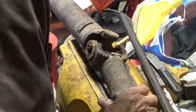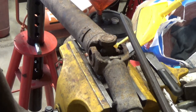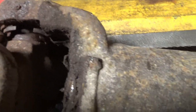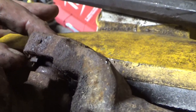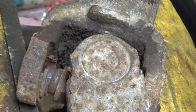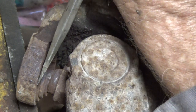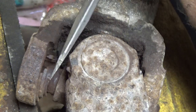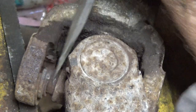This one has inside lock rings — I didn't see those. I've got to knock those out. Sometimes it's hard to tell when the u-joints are in better shape. That's a lock ring in there; I've got to get that out first. I think I might have this on camera now — that's my lock ring right there. I'm going to take a screwdriver and a hammer and just pluck that off, just like so.